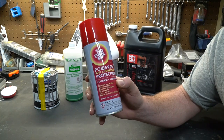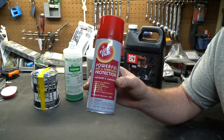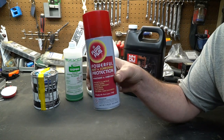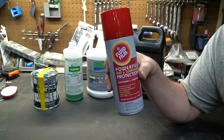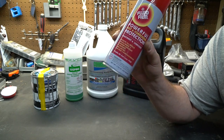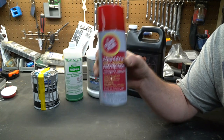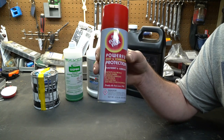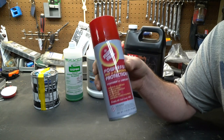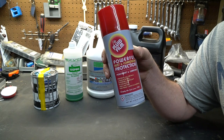This is Fluid Film. It's lanolin-based, which is kind of a waxy substance. I find the best time to use this is before things get too rusty — I don't think it creeps as well as the New Hampshire oil. I pretty much use this on things that are just starting to rust, like inside B-pillars or inside rocker panels. Once the rust gets too bad you really need an oil base. But this stuff is great for something new that you want to protect — get it inside the rocker panels, inside the B-pillars, and they'll never rust again. Get it inside the doors at the bottom where you have those pinch welds and you'll never have another problem. I have areas on my truck sprayed with this from years ago and you can still take your fingernail and peel it out — it just feels like a wax. It works really well.